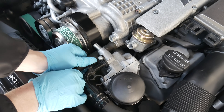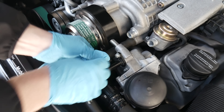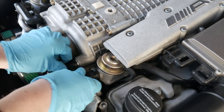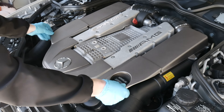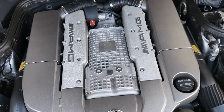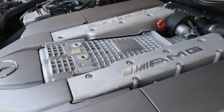After the bolt is in you will want to replace those hoses for the secondary air system. Then put back the engine cover and this job is done. Changing the supercharger oil is something that should be done but only done once in a while — I recommend changing it every 60,000 miles.